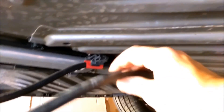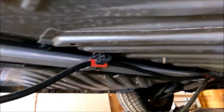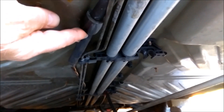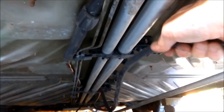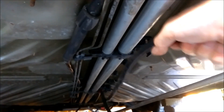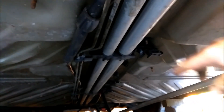I'm adding those two cables in, clipping them up into where the air conditioning pipes go, and then I'll put this tray back on. What I'm actually going to do is remove this vacuum pipe because the vacuum is all now done in the front, and instead I'm going to put the 0 volt cable in where the vacuum pipe goes because it's the same diameter.